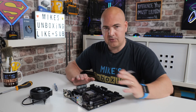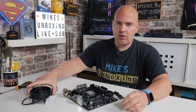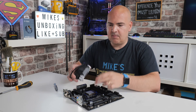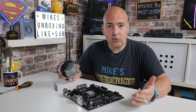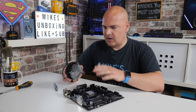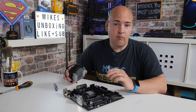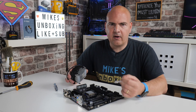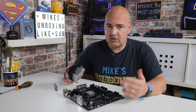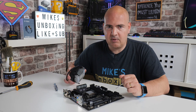That is all you need — you do not need a lot of thermal paste. Quite often what we see is if you use too much, when the cooler gets put onto the processor it squishes out the excess, and you get a build-up around the outside edges — a thicker edge all the way around. That is the bit which actually glues the processor in. With a very thin layer, it's only going to contact the areas where it needs to, which is ideally what thermal compounding should do. This helps when removing the cooler because you don't have that thick gloopy layer around the outside edges. Also, if you're buying more expensive paste like Thermal Grizzly — which is quite expensive gram per gram — you're going to save money and get more applications out of your thermal paste.